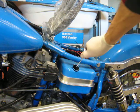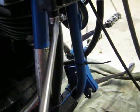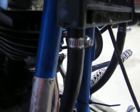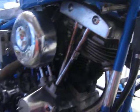Don't forget to put your oil back in your bag. I've just checked every single clamp with a good screwdriver like this, and I was able to get a lot more torque on all these clamps — because you don't want any of these clamps coming apart when you're riding. You'll lose your oil and you'll be stranded on the road. I'll just point out what an old worn oil hose looks like. You may be able to see that it's got very small cracks in this area here, and if you ever notice anything like that, you want to get onto it and replace that hose as soon as you can.